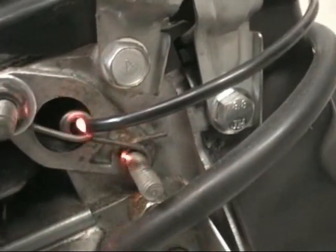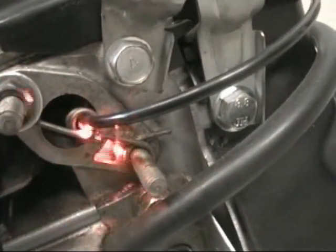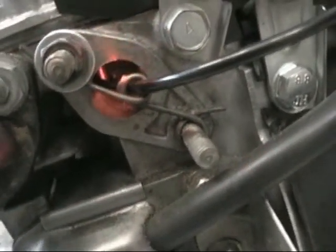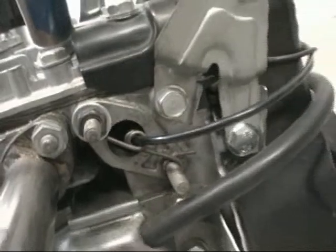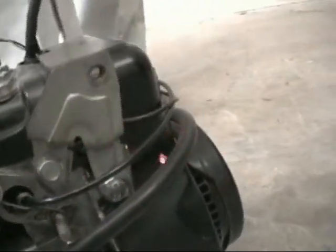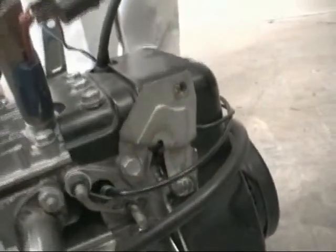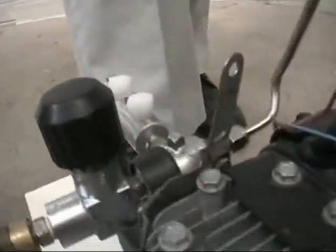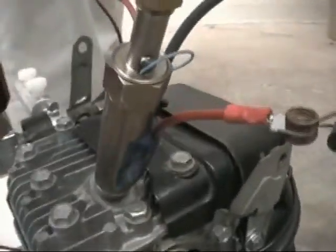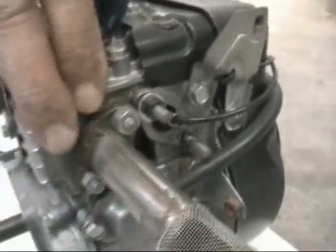Stainless steel tubing that's held in place by a piece of wire, and it's going right on in as close to the intake port as it can. That's right. It's aimed at the intake opening as the intake valve opens. So there's no $1,000 injector in this line or anything. You're just regulating the hydrogen flow with the needle valve over here. That's right. And we're doing research on the difference between stratified charge combustion compared to homogeneous charge combustion.